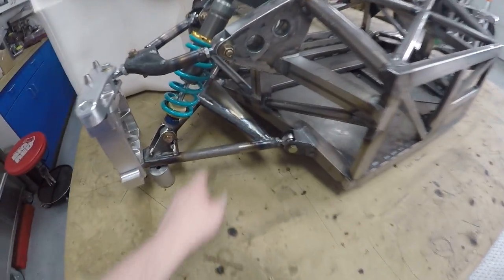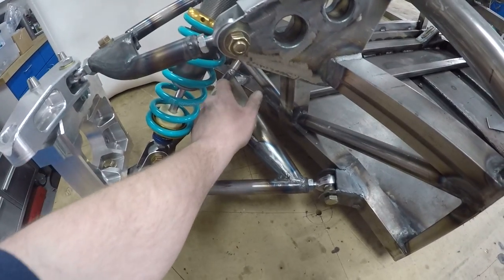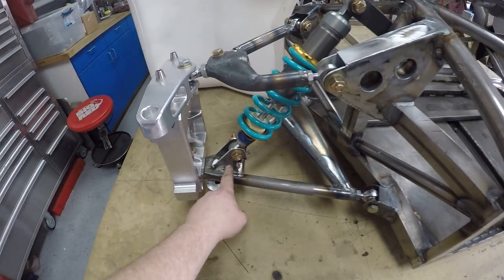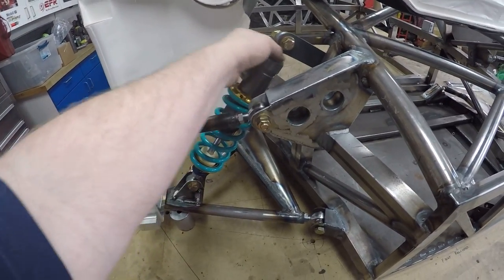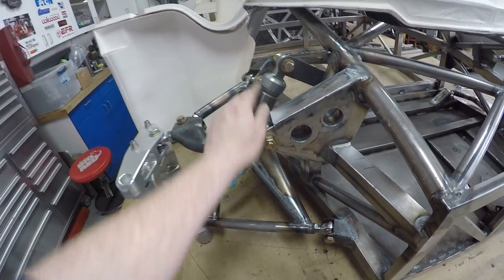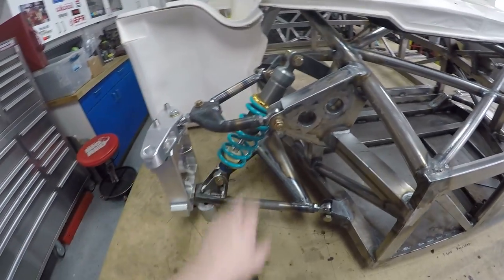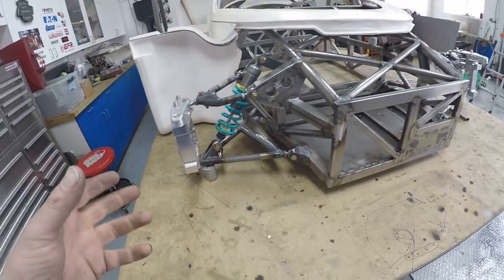The front suspension is together now and all welded up. There's the fillet plate in here - this is 1.2mm thin sheet, and this section is 3mm. I'm just starting to mock up the shock absorber position. These are the shock absorbers off my own car, but we'll use the same company - they're high-quality Nitron units - and we're probably going to get a remote reservoir unit instead of the base shock.